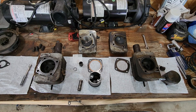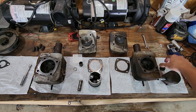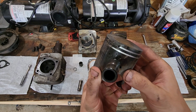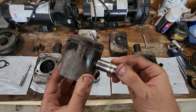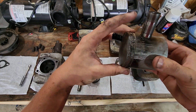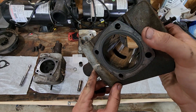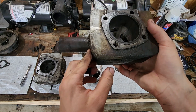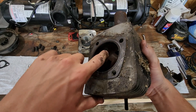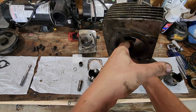This engine is going to sit here with cloths in it until we can track down some parts. Anytime you're doing an engine, keep your parts organized — don't be mixing up cylinder heads, jugs, pistons, or anything like that. This was our bad cylinder, which was the PTO side — the clutch side. You can see it's torched: piston dome is pretty chewed up in the corner, rings are seized up, locating pins are still in there. That is one torched cylinder wall — it's all beat up and nicked up, so we have to get this one repaired. It looks like there's a sleeve. Rule of thumb: you don't want your fingernail catching on any part of the cylinder walls, and this one's definitely got some scratching.